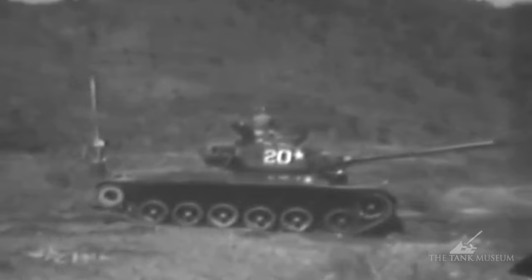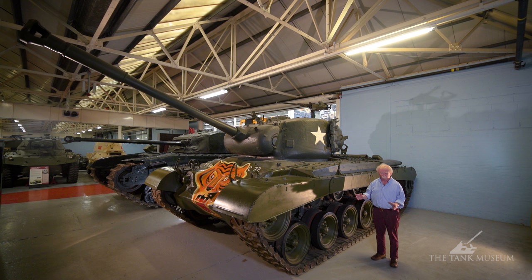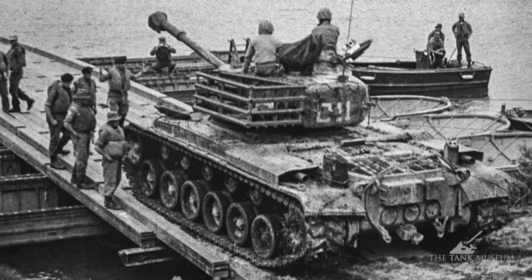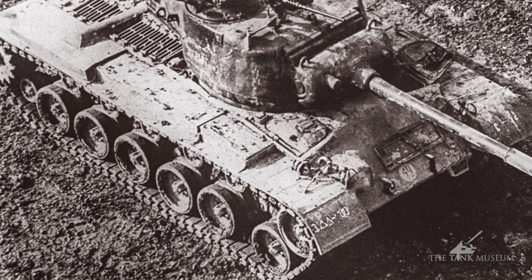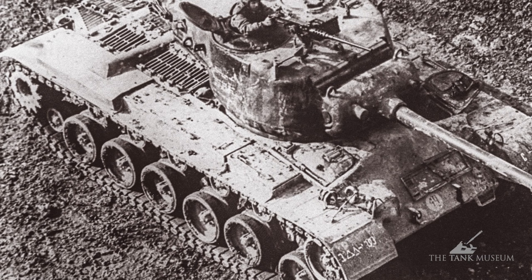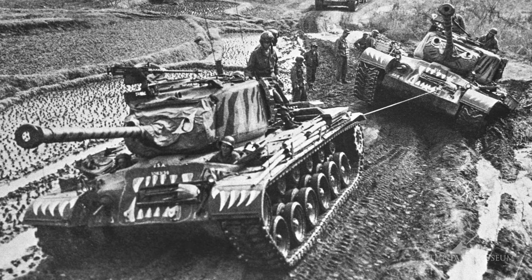The suspension is torsion bar, and that's another thing that really needs explaining — the origins of torsion bar. We know they came in with the M24 and the M26 during the war; before that the Americans had used the vertical and horizontal volute spring suspension. But why they suddenly went to torsion bar, where that idea came from, we don't know. The tank has a rear drive sprocket, and you'll notice on the M46 that the sprocket is a lot higher than it is on the M26, because the final drive is different and comes out at the top, giving a more level run with the top run of the tracks. But otherwise it's an interesting tank — mostly cast, the hull and the turret, all in large castings, which really are the best as far as being bulletproof is concerned.